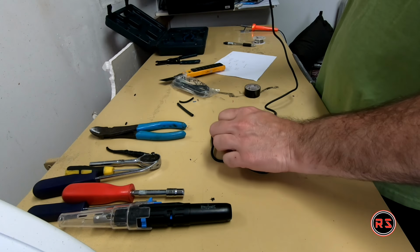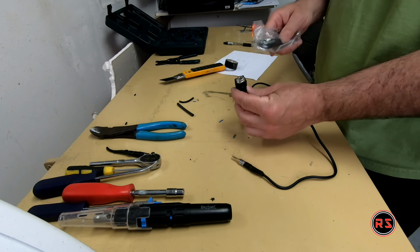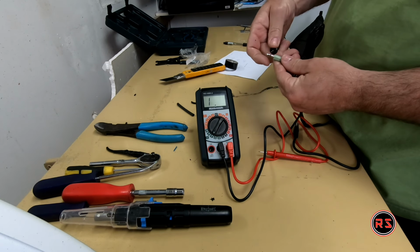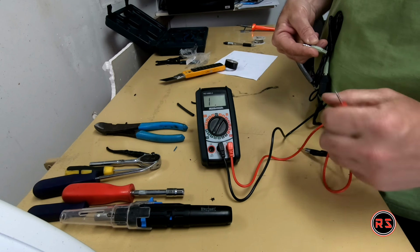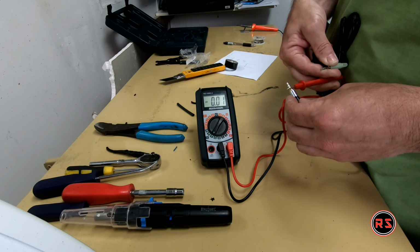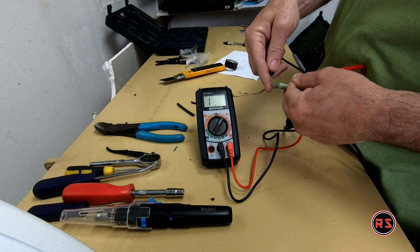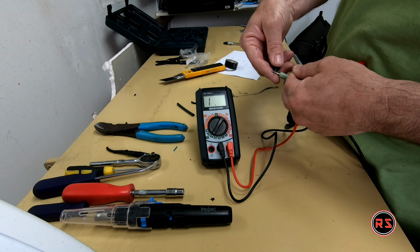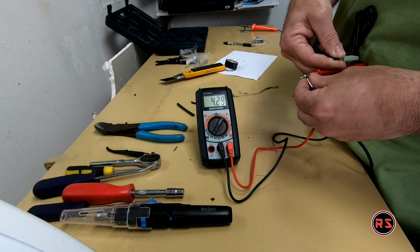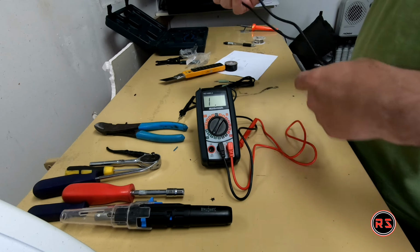This is it. Now it's done. The way we can test it is to connect another cable at the end. If we start with the bottom, we got a signal. We start with the middle. If we go to the tip now, we got a signal. If we go in the middle, we got a signal, so our cable is fine, ready to be installed in a truck.